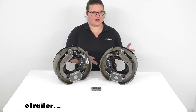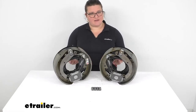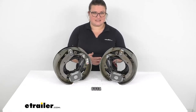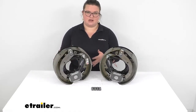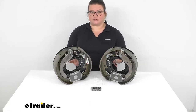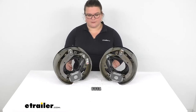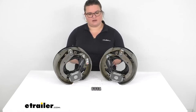This comes with your left hand and right hand side brake assemblies for your trailer, so if you're adding brakes onto a trailer that didn't have them before, this is a great way to do it. It's a much easier install than putting in a hydraulic system — you don't have to worry about running hydraulic lines or getting an actuator. All you really need to do is put these on there, connect power and ground, and get a brake controller for your towing vehicle. Other than that, it's pretty simple — just an electric connection between the towing vehicle and the brakes.